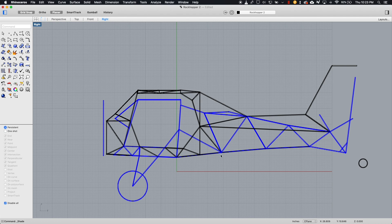Now what are we retaining? Well most of the aft structure is the same - all of this blue you see in the back is going to be saved. A few areas up here will actually be cut out, and of course all of the stuff in the front will be cut out and changed. We are retaining most of the original floorboard structure up to about halfway through the motor box. Forward of that it's all new, but after that this is an original rear section. Shutting off the old version and putting the stick figure back in as an overlay, you can see how much better this is going to work. I fit in very well, even with the firewall two inches shorter than it originally was. There's plenty of room in front of my feet for rudder pedal structure and motion, and with the much higher birdcage structure and top, I can actually sit higher.